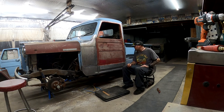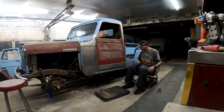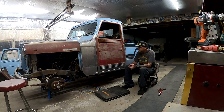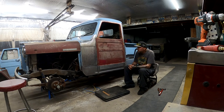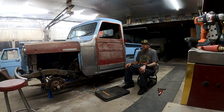Once the door's done it's on to the fender. I may take the door off, trim an eighth of an inch off the bottom, slip the door skin back on, tack it at each corner so it can't move, and then start hammering it all flat. But that's it for me guys — it's 11 o'clock at night, so I'm out.